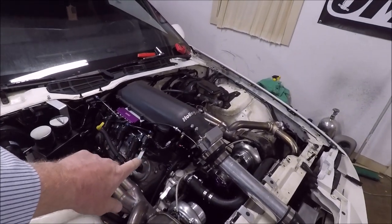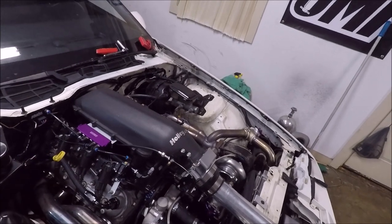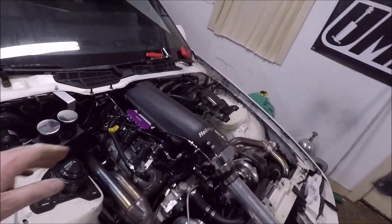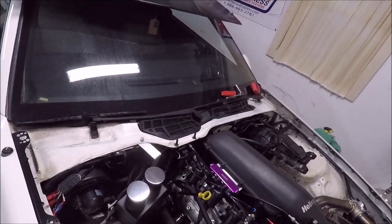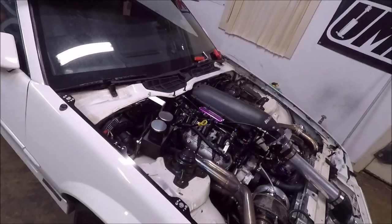We've got our smoke machine. I'm probably going to go ahead and smoke test all this to make sure I don't have a vacuum leak somewhere. If that checks out, then I think our whole problem is in either the harness or that pin A18 or A16, whatever that ground pin is in the Holley ECU. So stay tuned. We'll try to get that figured out.